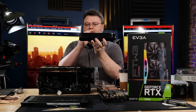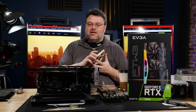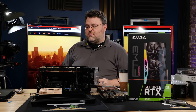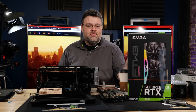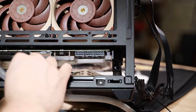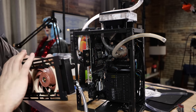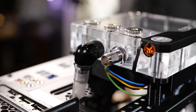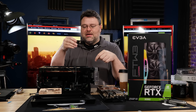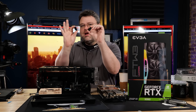We've hit a little snag in the build. I've got the thin radiator for the bottom — 240mm — which is pretty much your only option in the bottom of this case. I've also got the Noctua slim fans. In order to give the radiator connections clearance, your only option is to mount the fan on top, because otherwise it won't clear the graphics card. With the Vector FTW3 we actually had to take off the RGB end piece — it gets in the way. I've got the radiator mounted in the front, and the tube will run down parallel to the graphics card.